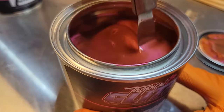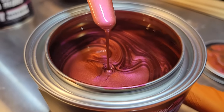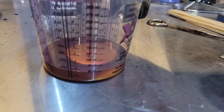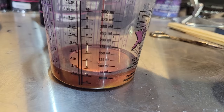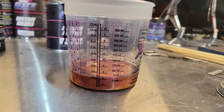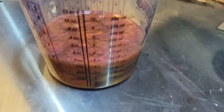It's really important to give your project the proper flash time — it can be anywhere from five to fifteen minutes depending on your temperature. Here we're mixing Apollo, a chameleon color. This is a one to one mix ratio and we're going to go into two ounces of material. We went over by a hair, but we're going to compensate that with the reducer to make sure we have equal amounts of product.